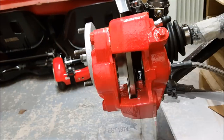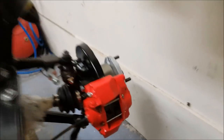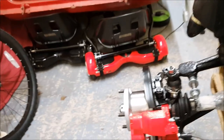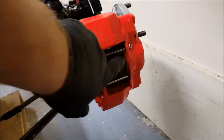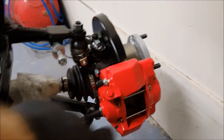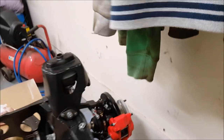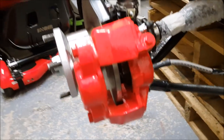We're now going to be installing the brake pads. Right, so we're going to fit the brake pads here. I fitted them on the other side, as you can see. Hummed and hawed whether to do it or just leave them until it went in the car. My main concern is I didn't want it scratching the disc or rattling about, but when I fitted these ones here, they're actually quite tight. And what I'm going to do is, inside here from this side, put just a small tissue in just to protect the discs. Not that they're going to get rattled about anyway, so that's my reasoning for doing that.